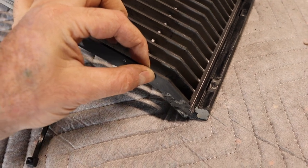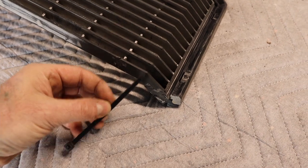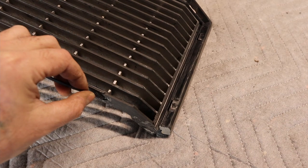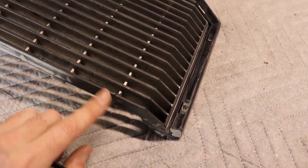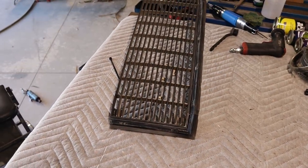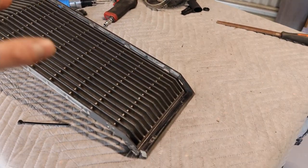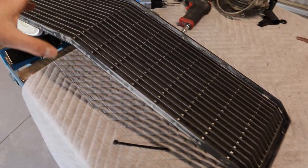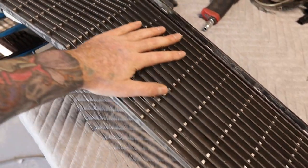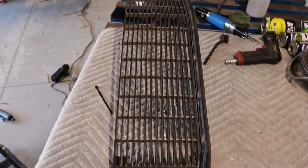That piece is now attached — I'm pretty stoked with how that's turned out. I've used a soldering iron and a cable tie to fill the gaps: you just melt the cable tie into the gaps with the soldering iron and blend it in. I've also cleaned everything up with wax and grease remover and a scotch bright pad, and sanded the outside flat surface. Pretty much ready to prime it now.